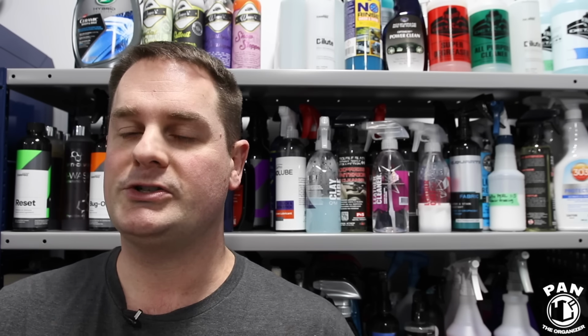Tip number five, avoid working under direct sunlight and also work on cool surfaces. So either in the shade or in a garage if possible. If you have to work outside, try the earliest in the day or very late during the evening. That way the sun is not at its brightest, because the majority of the chemicals that are used today are made to be used in room temperatures, so standard temperatures and humidity as well. So just keep that in mind.